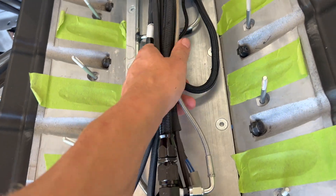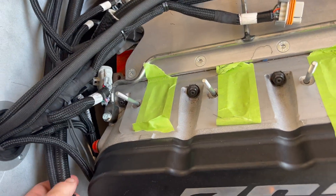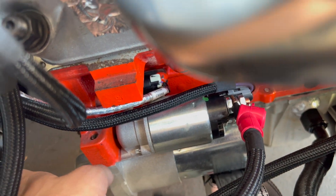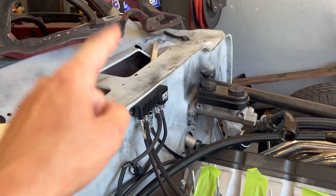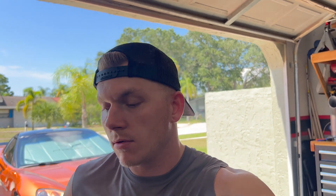We've got just a few things laying around here - trying to tighten up this bundle a bit so we can lay the intake manifold right on top. It's been a few days of wiring and cleaning stuff up. We were waiting on a connector for our starter for the LS-style starter. We got our crank sensor plugged in and relocated our coolant temp sensor. I had a quick chat with Steven, the guy who sold us the wiring kit and the leash board and the Race Wire Solutions switch panel. I was going to try to use the input and output auxiliary harness off of the main harness, but that plan quickly deteriorated - I should have done a little more research. But we figured it out.